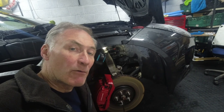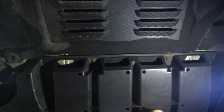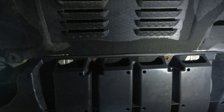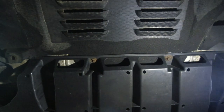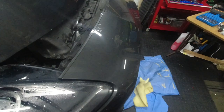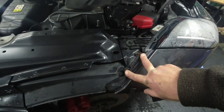I'll go to the other side and then carry on. Underneath, this lower front bumper pan has one, two, three and four ten-mil bolts to remove. That should release this undertray from the frame of the car - the rest of it is held on with bolting over the front, so it will come off with the bumper. Back on top of the bumper we've got one, two, three, four, five, six along the front and then two on each side.